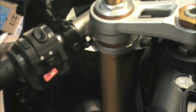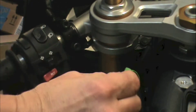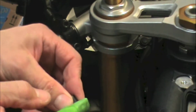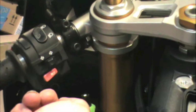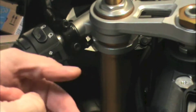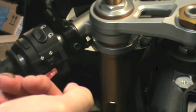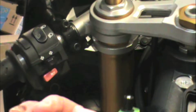But he talked about, why don't I just stick tape on my finger, which actually is a pretty smart idea, because you can touch where you want to go. You just can't get your fingers in there. You can stick the nut on the tape and stick your finger all the way in. You can kind of reach that side. It's not so bad. This is the worst side. But yeah, just get some tape on there. Tape one way, and then I taped it the opposite way so it wouldn't slide. And you can stick it in and get it lined up how you want it, and you can run your finger all the way up to it. So that's kind of a cool idea.